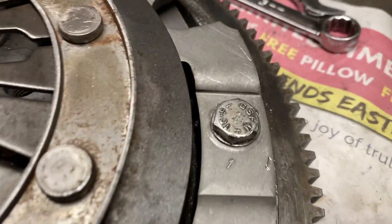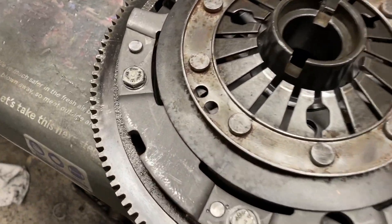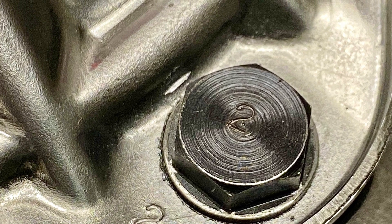One of the last things I do is to number the bolts so they only go back in the same place. That way we can make sure that the balance is maintained. I also do the same with the bolts in the pre-Verto flywheel, so that again they always go back in the same place. I hope you enjoyed that video on balancing. If you're doing any kind of competition work, spend the money and have that crankshaft and flywheel and front pulley all balanced together on a dynamic machine. However, if you just have your flywheel and you're doing road work, then static balance is perfectly ideal, and it's served me and many customers I do these for for very many years.